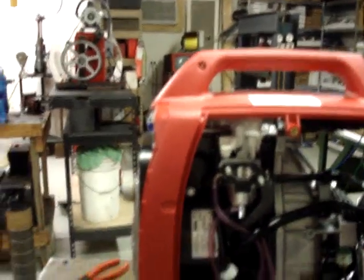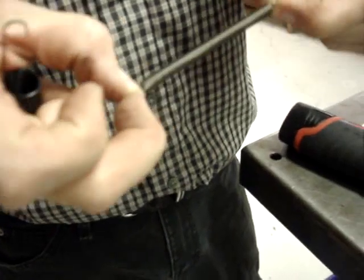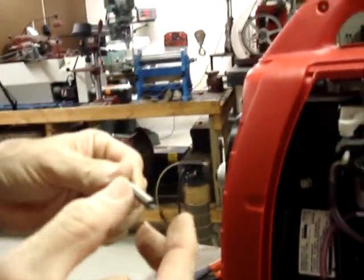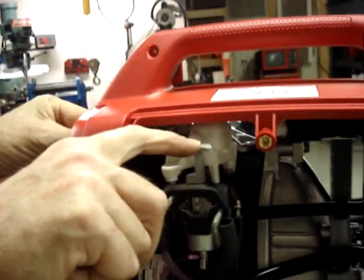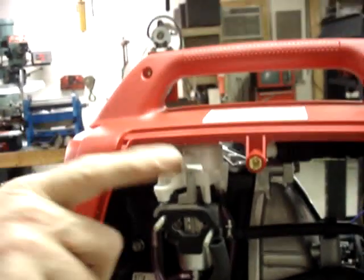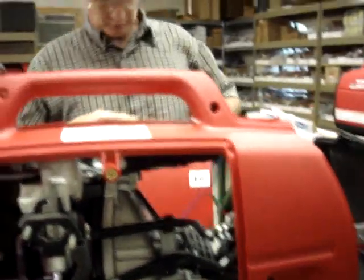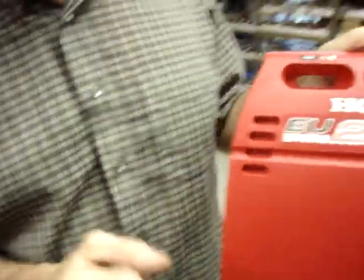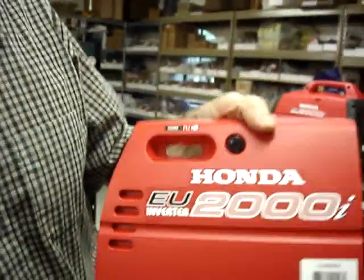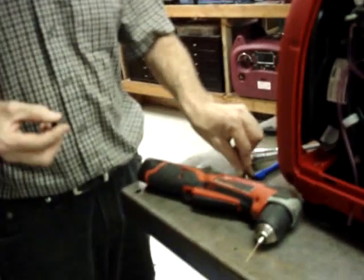This is the actual spring that will be used for the choke return spring. The whole purpose of using this fine a spring, it's going to go to a stainless steel wire that links into this, but that way the whole thing can protrude out through the choke cover without creating an unsightly mess. Viewed from the outside, it'll look totally stock. And that's kind of what we're after. Kind of mess with people's heads a little bit.